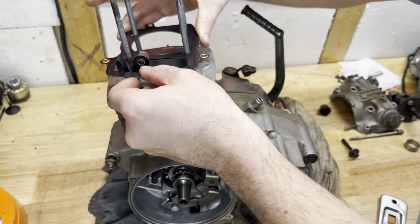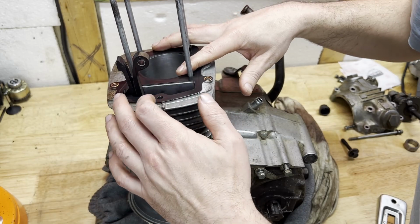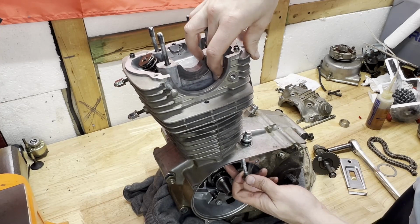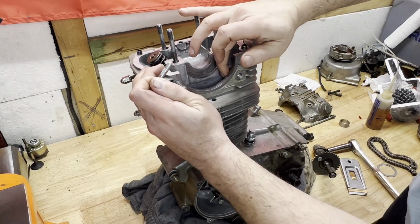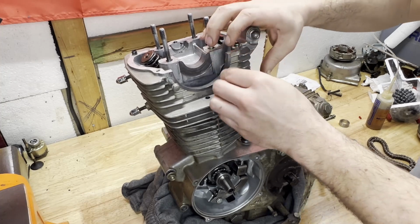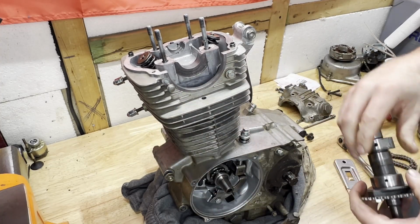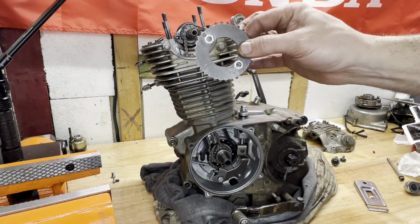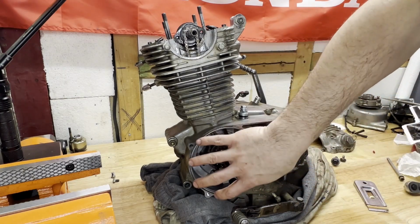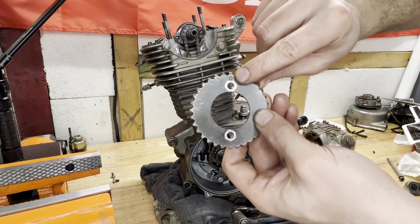Next up, head gasket. And put this upper bolt in for the guide here. Get this lined up. Just gonna snug that up for now. So I ended up taking off the cam sprocket just because I completely forgot about trying to get the cam chain over top of that while it's up there. It's kind of tough. So once I get all this buttoned up, I'll be able to just slip this on whenever the cover's on and then work the chain around so I can get the marker here lined up with the top.